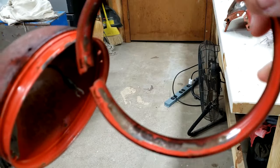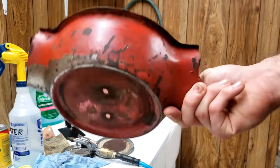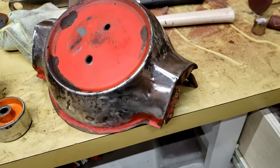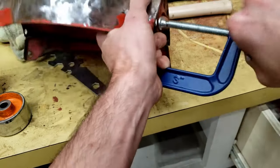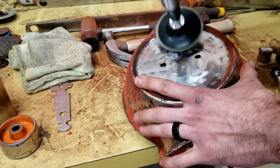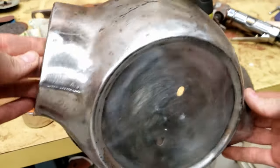Here is the reveal — one side is the dirty uncleaned side and the other is the cleaned side. The emblem holder front section, which will probably be the first thing I try to paint, cleaned up pretty well. I then tried my hand at getting some of the dents and ripples out using a little clamp — I don't really have many metalworking tools, but it worked kind of well. My grandfather-in-law might be able to lend me some. I also got a die grinder at Harbor Freight to strip off some of that enamel paint, which worked out well, then hit it with sandpaper afterwards to clean up. I'll have to remove more dents and paint later, but overall I think I'm making good progress.